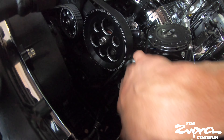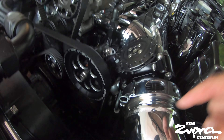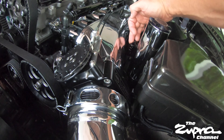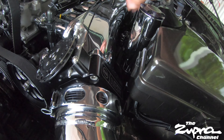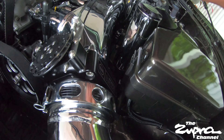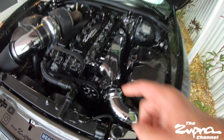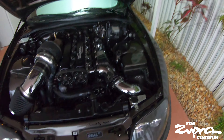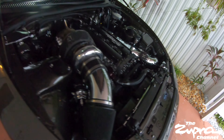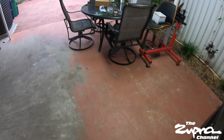This bypasses that whole factory tubing that goes under the oil pan. I actually bought that hose brand new back in the day, probably 10 years ago — it was almost $400 from Toyota. It's been in there, it's never leaked, but I'm going to clean it up and get rid of it now. Technically it bypasses from the pump straight to the rack on the high pressure side, and the other one I have braided. The new high pressure material hose is going from the reservoir to the rack, so I'm going to change the fitting, both lines, and the o-rings on the canister.